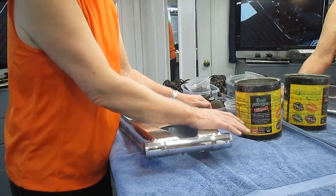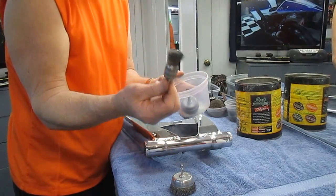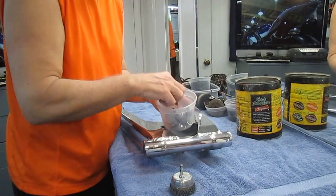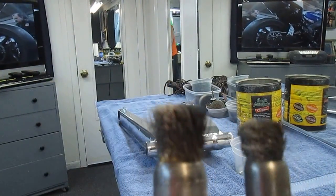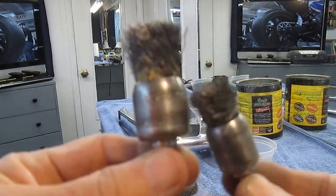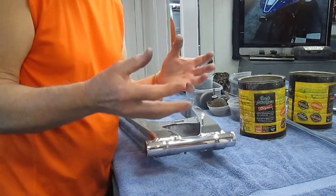Now if you have no deep corrosion, you can take a soft wire brush in any shape and put it in a drill press — the little ones get in corners and edges nicely. The brushes that are gold are softer than the ones that are silver; the gold ones are usually copper-plated wire. They come in at least two grades at Lowe's, about three dollars each. For ten bucks you can cover a lot of corners and edges, though it can still be difficult to reach everything.